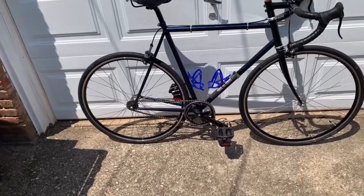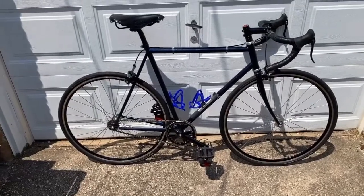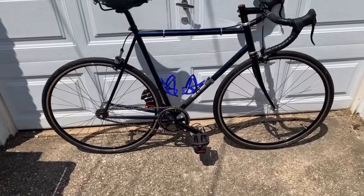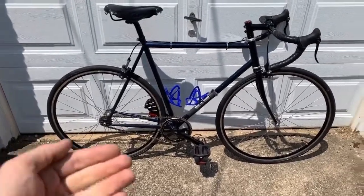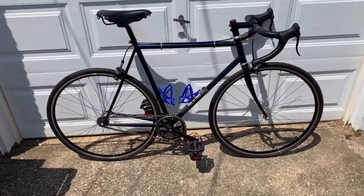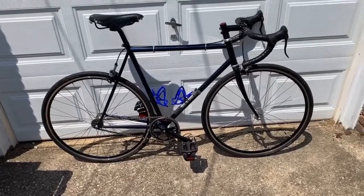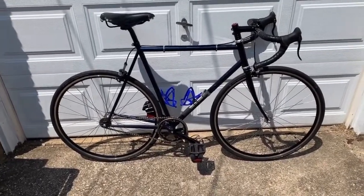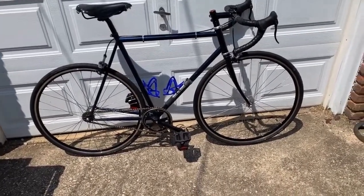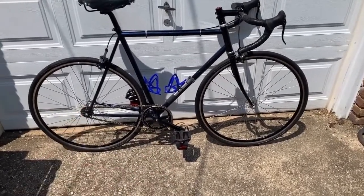But what a fixed gear does is it forces you to keep pedaling. For me, I end up going faster, and I can still kind of back off a little bit, but it's almost as if the back wheel carries the momentum to pull me forward. A little bit tough on downhills. Sometimes it spins out a little bit too fast, but give and take. For me, I like a fixed gear. If it's a single speed, it's going to be a fixed gear. If I want to coast, I'm just going to hop on my other geared bike that's in the garage. And if I really want it to be simple, I would just run a 1x, you know, just 1 chainring in the front and a couple in the back.